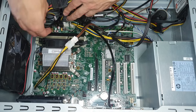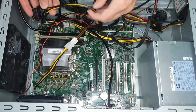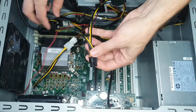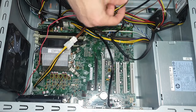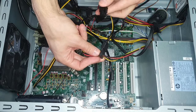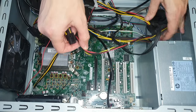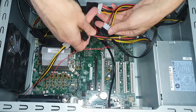To use the GTX 960 in this PC, I need this 6-pin connector, and I have here an adapter that converts two SATA power connectors to one 6-pin power connector. If I was using a lower powered GPU, like a 1050 Ti, I'd be comfortable using one SATA to 6-pin adapter, but since the 960 needs more power, better share the load between two SATA power connectors.